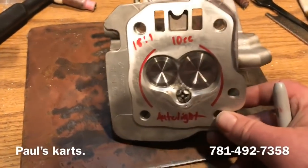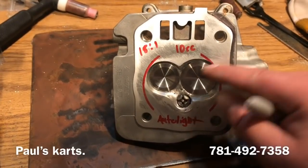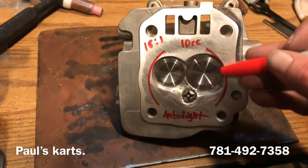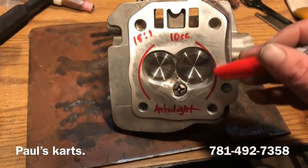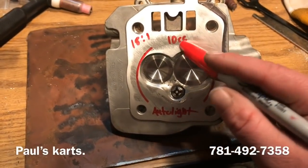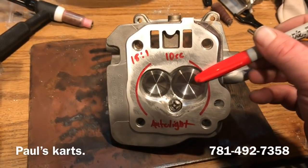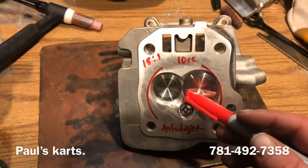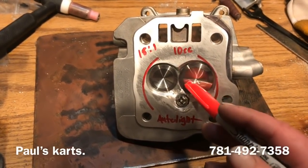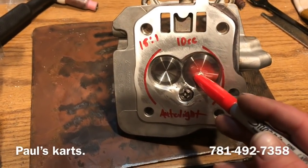If the valve was properly clearanced — clearance up here and correctly clearanced down here — the only real area of shrouding technically should be the outer limits of the cylinder wall or the head gasket limits. So now if everything was properly clearanced and you went from a 25 to a 32 millimeter valve with only say 18 percent of the valve shrouded, you'd have 75 cfm minus 18 percent — you might pick up from 50 cfm with the 25 millimeter to maybe 60 cfm. You would still see a gain in performance.